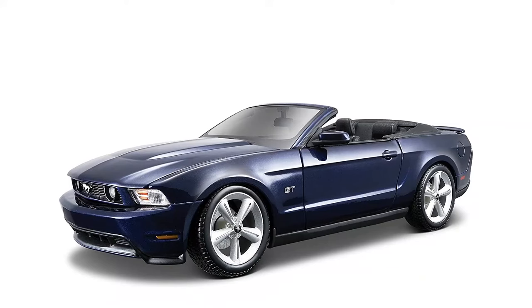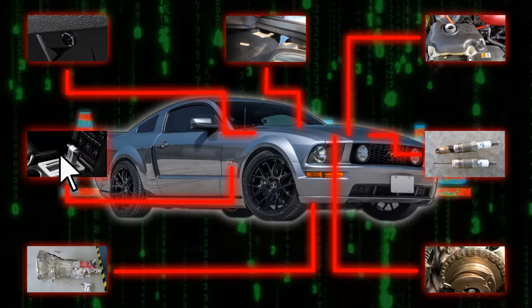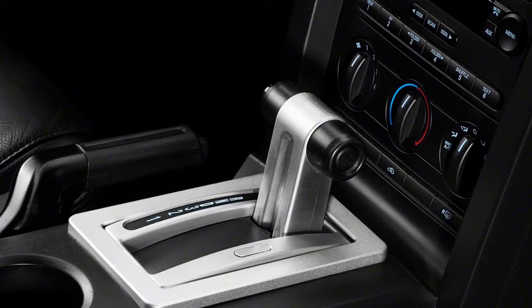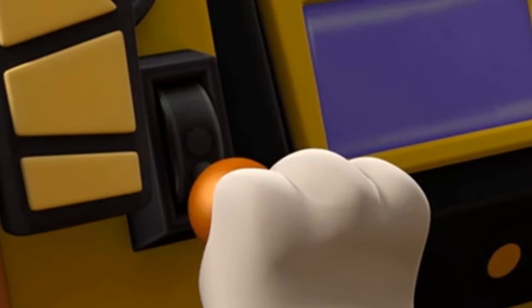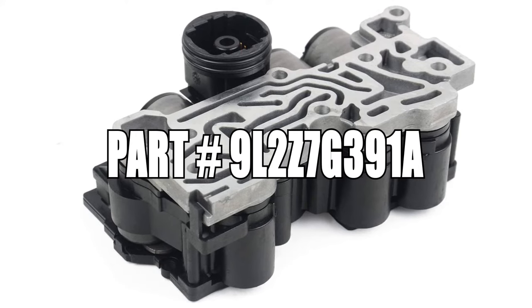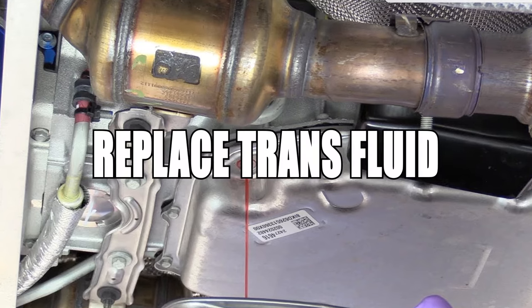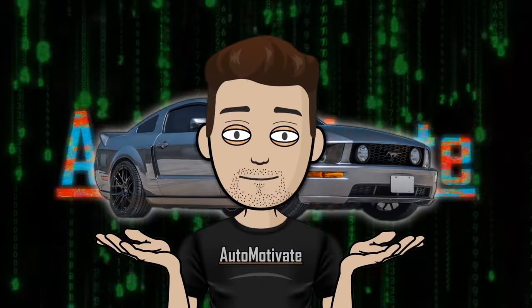So if you have a convertible, you cannot safely place your stuff in the trunk. In the V6 automatic transmission for these years, it has hard shifts when put into reverse. The fix seems to be replacing the solenoid part number 9L2Z7G391A and replacing the trans fluid. Owners reported the car shifted like new after they changed out that part. And that's the bulk of the issues for those years.